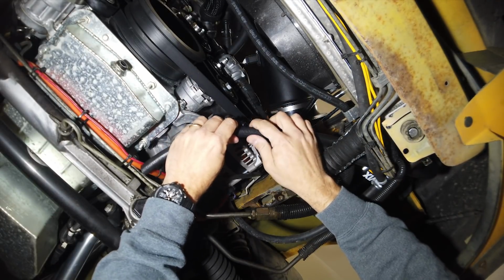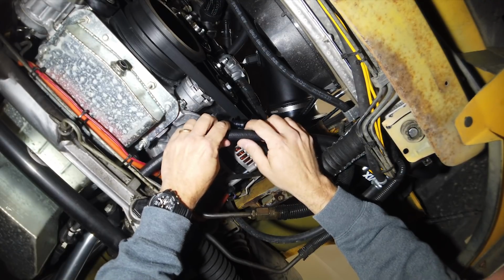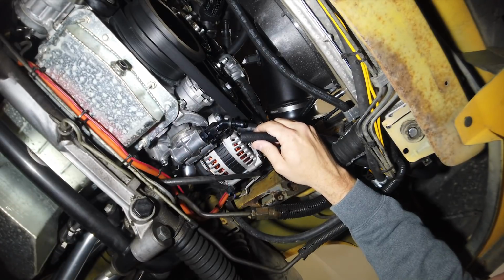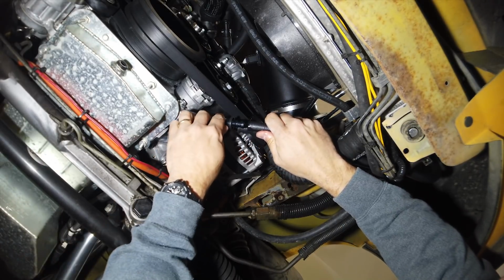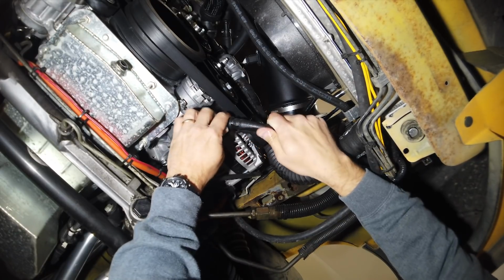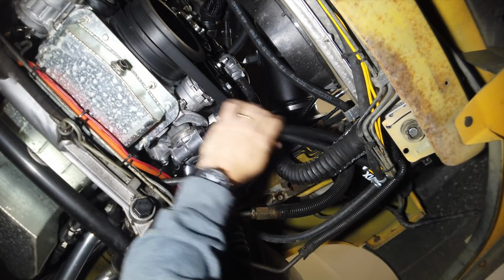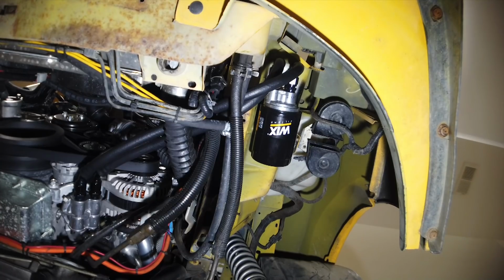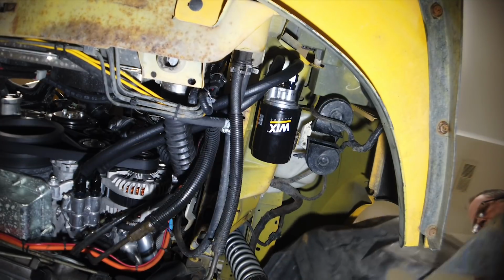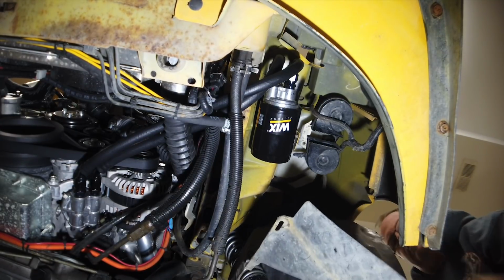Even after removing the stock oil cooler, I ran into another issue with the oiling system. I don't know if it works on a stock setup, but both the QA1 sway bar and the oil filter wanted to occupy the same space. To make it all work, I used a remote oil filter kit from Hedman that moved the oil filter up inside the inner fender. This also gives me room to use a much larger oil filter, which I definitely appreciate.